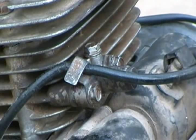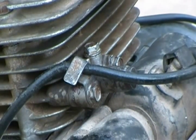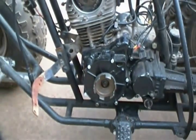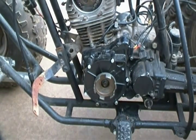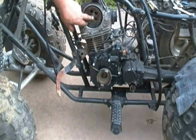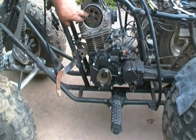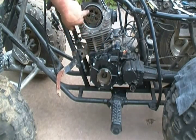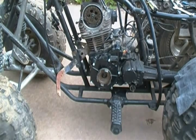Got that wire running up on it, got a little clip holder there. You hold this with a socket while you tighten this. I had to do it like four or five times in order to move it one tooth at a time, so that when it was in place the timing marks still lined up. Alright, so then you move on — you're good to go there.